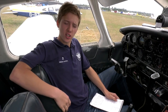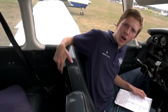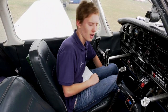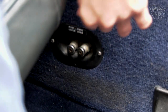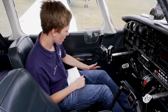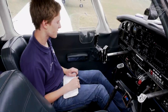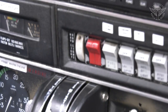Similarly, you need to know where the first aid kit is. In this instance it's behind my seat, but it could also be behind the other seat. Now for the pitot and static systems — I'll need to move my seat back to show you. Overnight, water and debris can get trapped inside, so press these two plungers to release any muck and water from the pitot and static systems and ensure they function properly.